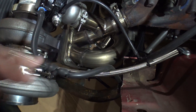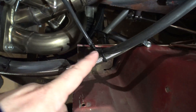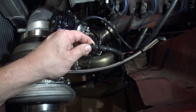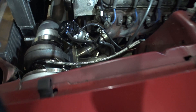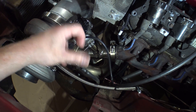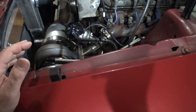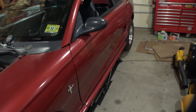I had just enough hose and fittings laying around to connect the wastegates. This is a reference from the manifold that used to go to a brake booster — this car has manual brakes so no booster. I've got this on a T-fitting going to the bottom of this gate and the bottom of the other gate, and the two tops are connected together. When I get to the dyno I can just add pressure to the top. This makes it way easier than trying to figure out what spring you want or how much boost to run. I'll just hook up shop air to the top and do whatever I want — even if boost is low and we max out a boost controller, we can throw 50 pounds on top and get what we want.